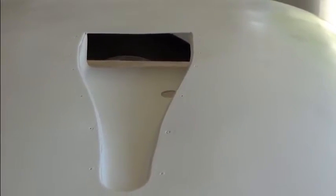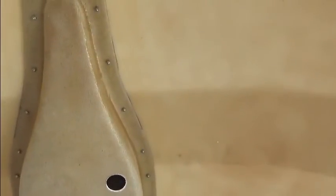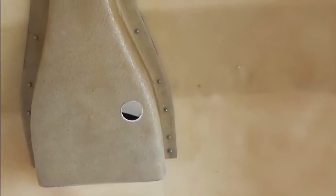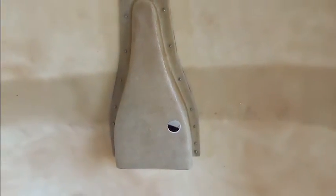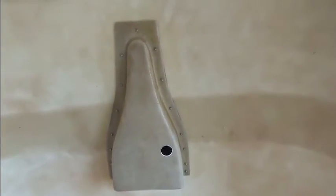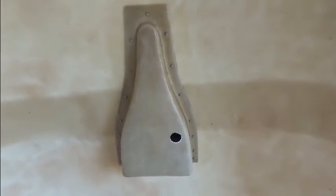Keep in mind that to position it accurately you'll probably need to drill some pilot holes and use some clecos to get this piece in position. It's not necessarily perfectly flat, and neither is the top part of the cowling, so you need to make sure this surface is flat up against the bottom of the cowl. I needed to use a number of rivets for it to remain flat, and once I put fiberglass resin all around the bottom it sealed up pretty well.